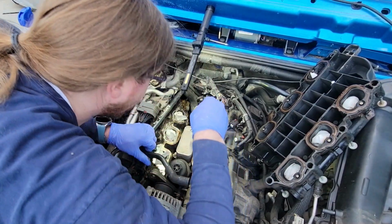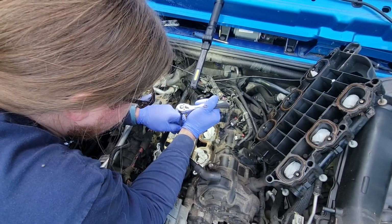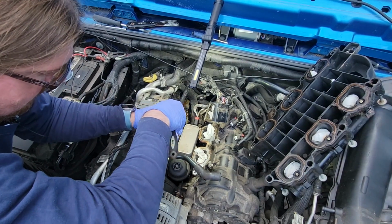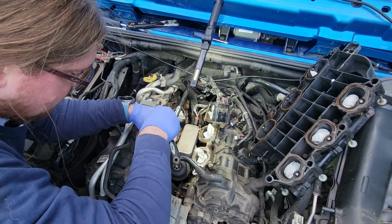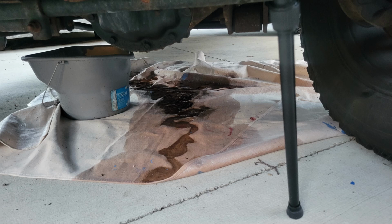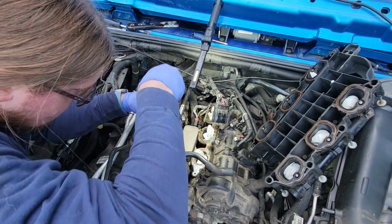There's another bolt. Nope. Two more in the back. Looking at the new one, there's ports in the bottom of this oil cooler. And judging by this big hose right here, it's an oil coolant line, I would have a bucket underneath ready to go, or you might have one hell of a mess on your hands. Where does the oil go into this? I wonder if this enters the bottom.